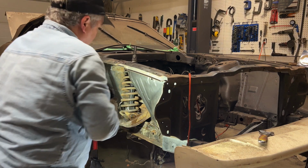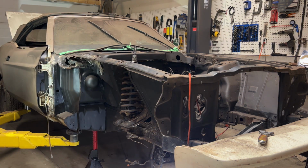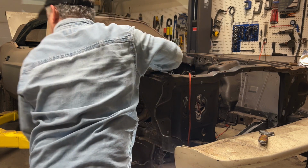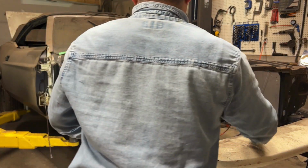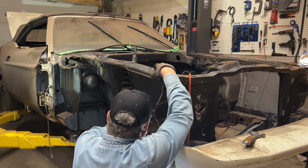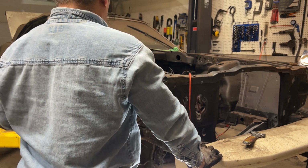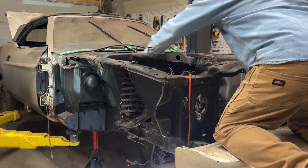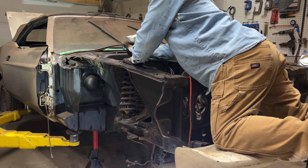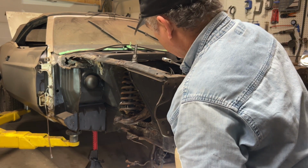Okay, I can actually see it lifted part of that perch off that spring. And it's the bolts there that kind of hold it. I want to see if I could turn that. If not, I got to crank it a bit more. No, I don't want to mess with that. Let's try a light tap from underneath maybe. Nope, don't like doing that. Okay, so let's crank her up a bit more. Nice thing about these Acme bolts, doesn't take many turns to get that thing to move. So you can see it's actually moved up quite a bit.